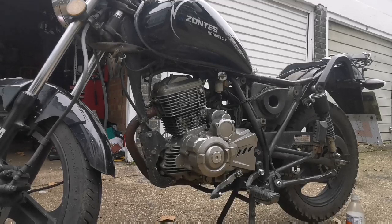Unless you can put a fuel filter in, there's no other way of fixing this. And the fuel filter just does not fit. And they're the smallest filters you get. The only other thing you could do is connect some sort of fuel pump, which is doable, it's not the end of the world, and then run the system around a bit longer with a fuel filter in it. But that's very complex for a little 125.